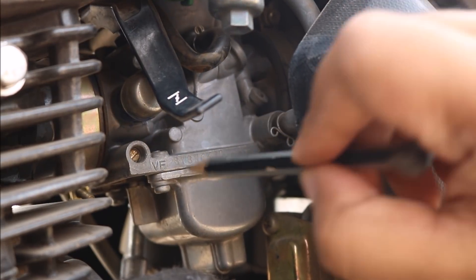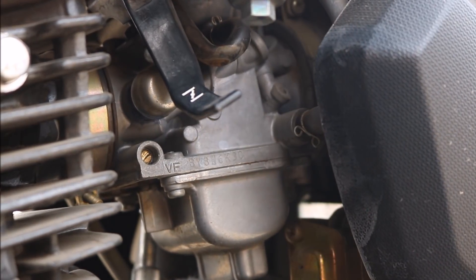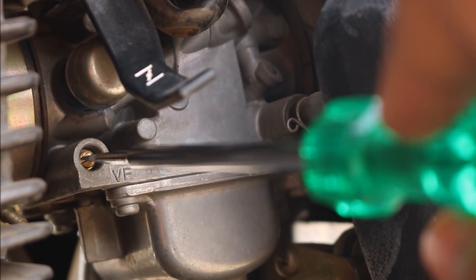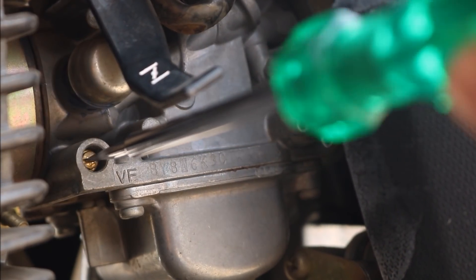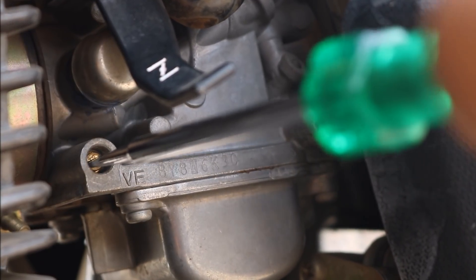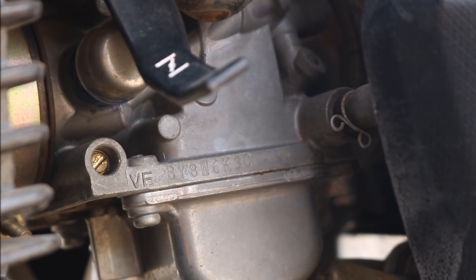This is the fuel screw which maintains the air-fuel mixture entering the engine. Mark one end of the fuel screw, which will help you in counting the number of turns as you open and close it. The first step is to close the screw all the way to the end by rotating it clockwise. Be gentle and don't press the screw hard as it has fine threads and a very narrow tip. You can count the present number of turns while closing it in case you want to revert to this setting.